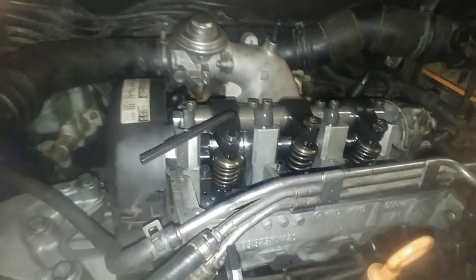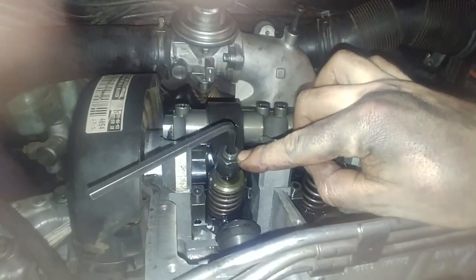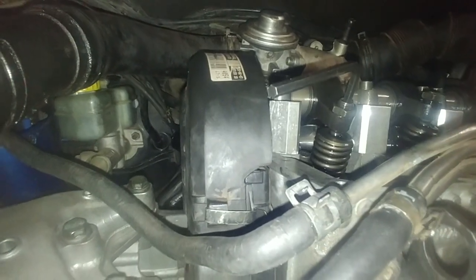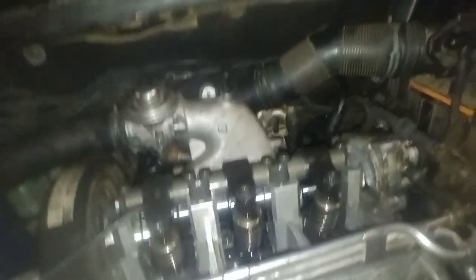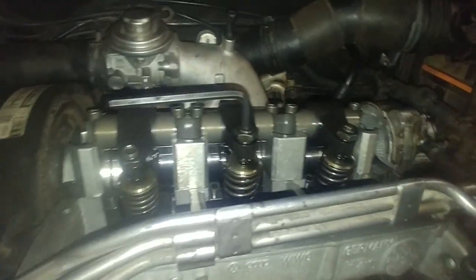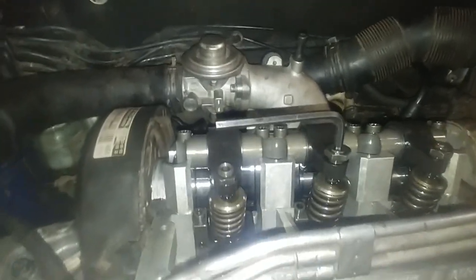Just to give you an example — let me see if I can do this with one hand. That's around about where it was; I'm just going to hand tighten that. This needs to be torqued to 30 Newton meters. I'm using this now as an indicator. The motor has a bit of resistance, so it's a very good idea to remove the glow plugs. We then just rotate it until this one's here. You can look at the back side — you've got the cam over there, so you should be at the maximum of this.